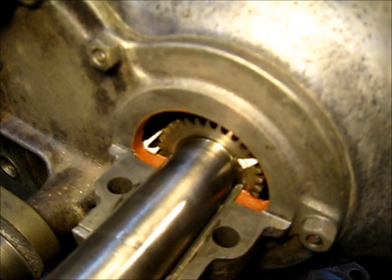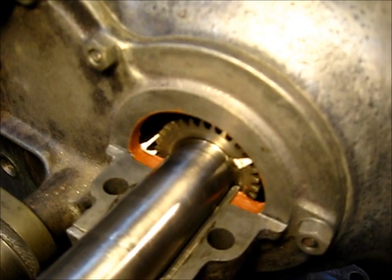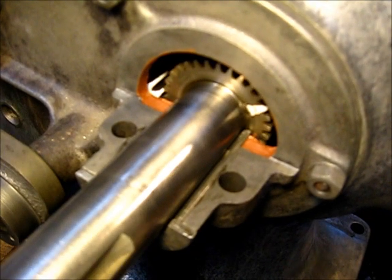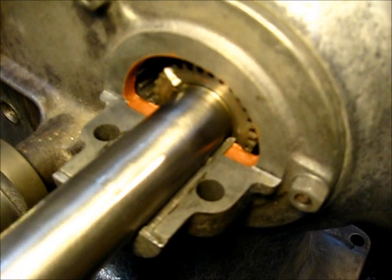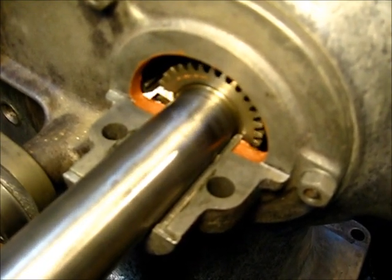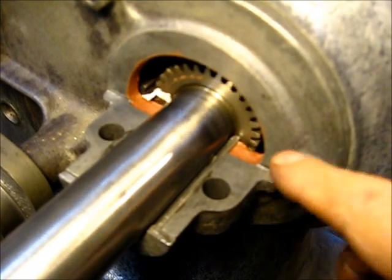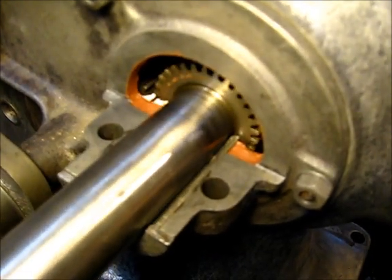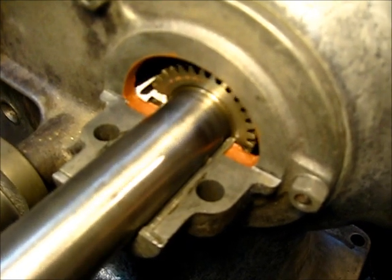With the bearing caps off, the crankshaft is free to move. All you do is pick up the crankshaft and turn it. If you can see when that comes around, that would be one tooth off — it would be half on that side. So you pick it up one more time, and when it comes around, those three teeth mesh in perfect alignment.